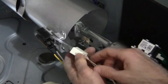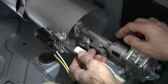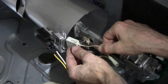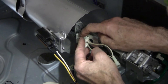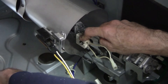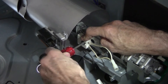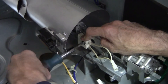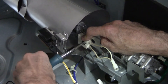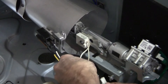There's a slot on the igniter that needs to correspond with the slot on the housing — they made it idiot-proof, it goes in a very specific way. We're going to line up that slot, bring it back all the way, and then tighten down the screw. A longer screwdriver works better here. Tighten that down — don't go gorilla tight, just go snug. Now we're going to reconnect our electrical connection.